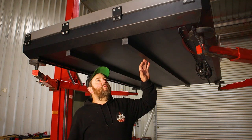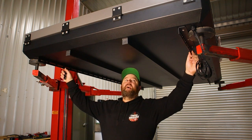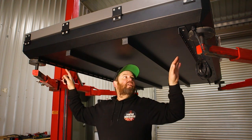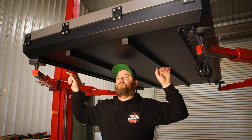They made a really simple one underneath the rooftop tent. You've got two main support bars here, which run the whole length of the rooftop tent. That helps support your weight when you're in the rooftop tent, and your two outer bars here which run the whole length as well — they're your mounting rails. They're designed to be right on the outside here to make it easier to mount when it's on your roof, and also having it as far apart as possible helps distribute the weight evenly.